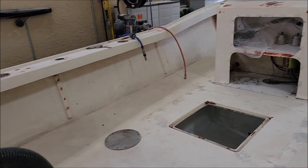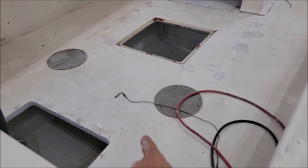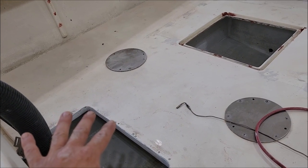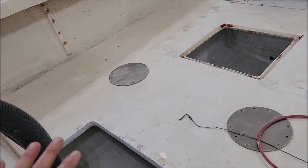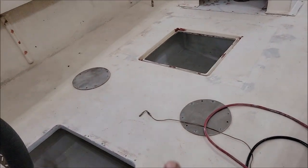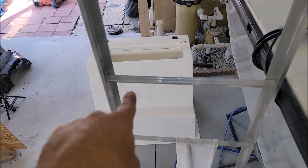It is a marine grade liner material, and it not only will add a thermal barrier, we're going to put in a thermal additive for the floor, which we're doing in whisper gray with also a traction additive. We want to make sure that feet don't get too uncomfortable. So whisper gray on the floor, whisper gray on the top edge here with the traction and thermal additives. And then we're just doing straight up texture on the gunnels, the console, that console right there.